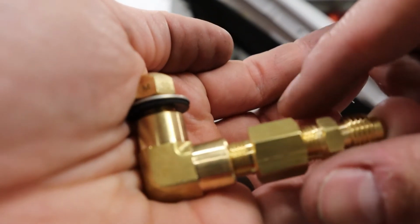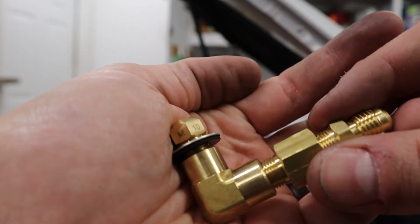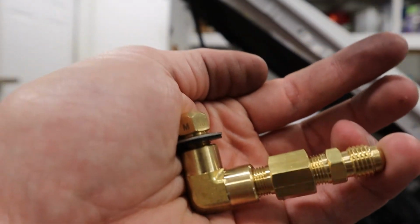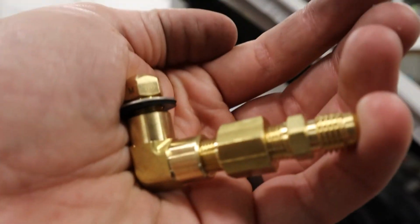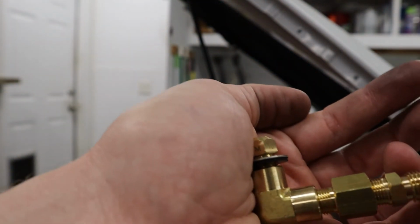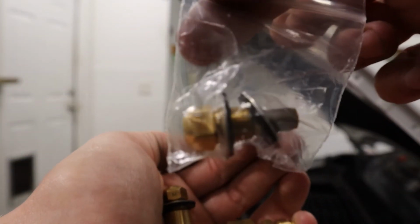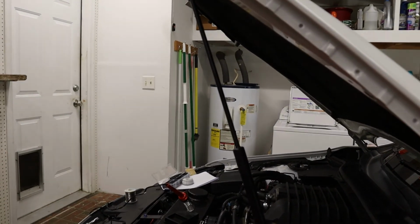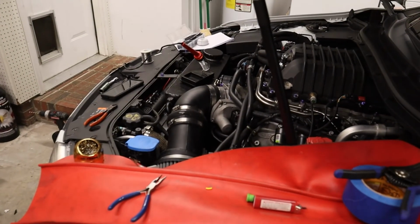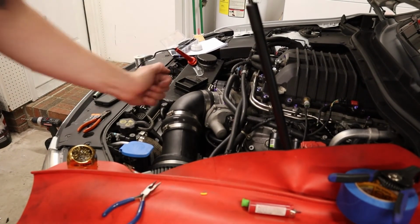For my car, we got a single nozzle meth kit. I don't know if you can see the numbers. Got an M10 nozzle. Yep, there you go. M10. We also have an M5 nozzle, just because, like I mentioned in every video, it's my wife's daily driver. Spare nozzle, M5. The nozzles go in the intake, if you've never done a meth kit. After your MAF, before your throttle body, so like right about here, but it's gonna be under the intake.